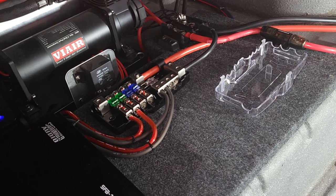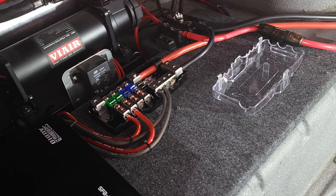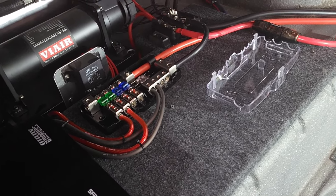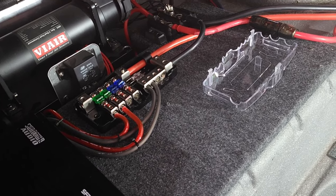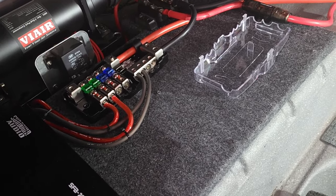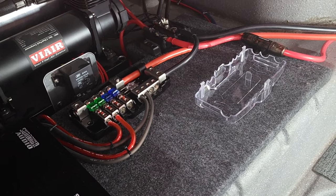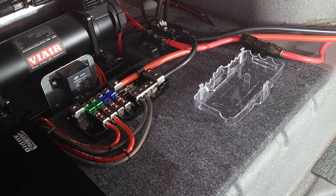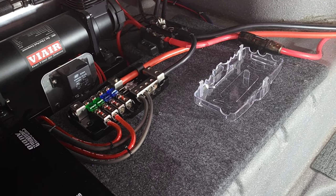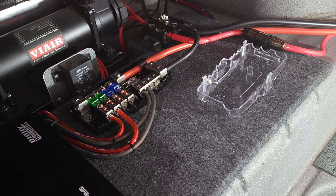The capacitor is only good for a one-shot deal. You're going to get that little push of power so it doesn't clip, or maybe so your lights don't dim. But as soon as that capacitor discharges, it's going to struggle to stay charged up if you're constantly hitting your bass. So I never saw value in capacitors. I put one in my previous car because it did help, because I did have a weak alternator. The lights didn't dim anymore, but you know what? Replace the alternator. I kept saying to myself, replace the alternator. I just never had time.